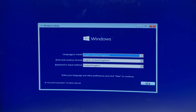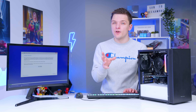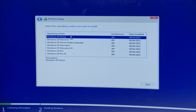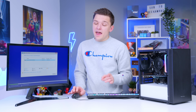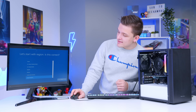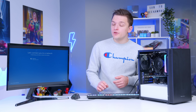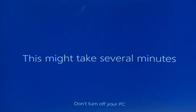Select your language and region settings and click Install Now. The process can be long-winded but we'll walk through it step by step. Enter a product key, or click 'I don't have a product key' — you can activate Windows by logging into your Microsoft account later. Select Windows 10 Home, agree to the license terms, choose to install Windows only, then pick which drive to install on. Once done, it will automatically reboot into your new Windows installation. A top tip: don't connect the internet yet, as leaving it off skips all the Cortana setup, making things much quicker.